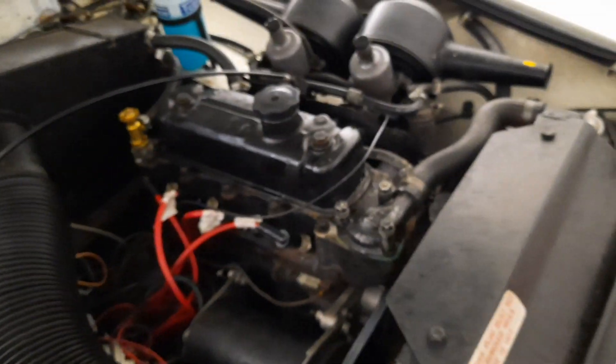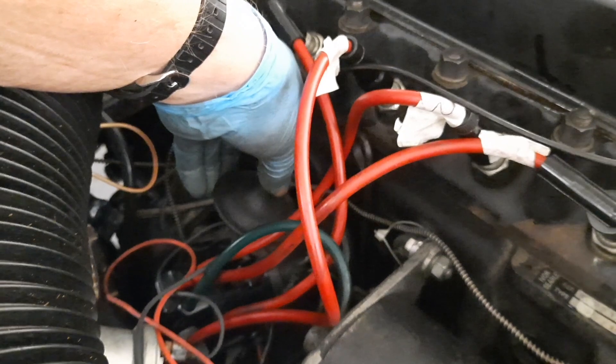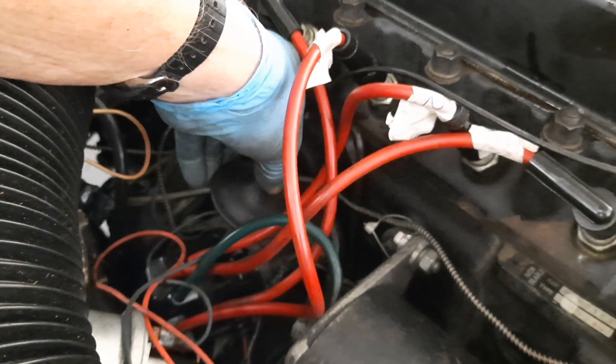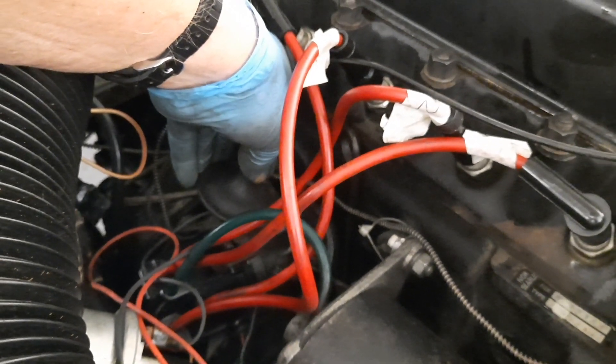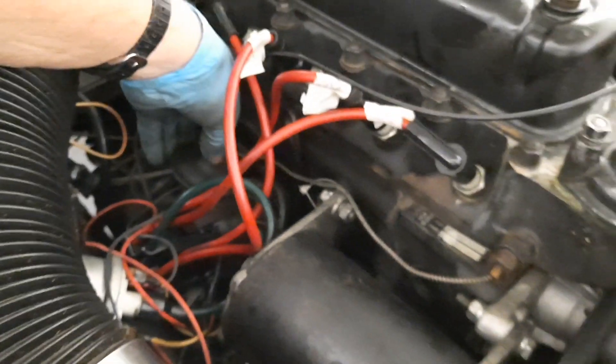Once that's done, it's ready to start — and as you'll see, we had a go. First run, putting the car back together, and it's running — Dave gives a thumbs up. He was managing to change the way the engine was idling just by moving the distributor. Next, we're going to set it up with the timing light.